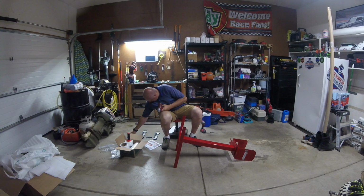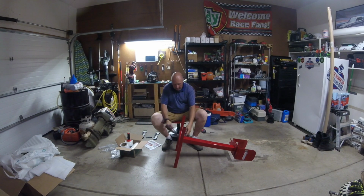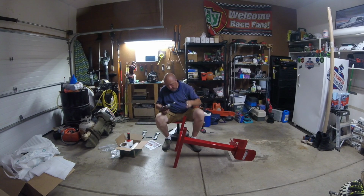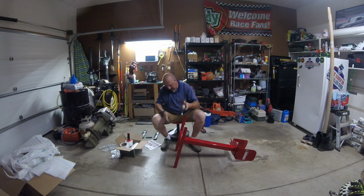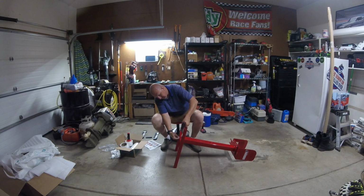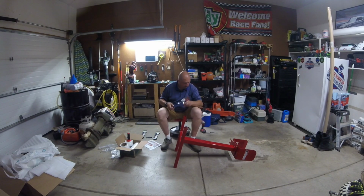So, grab our 9/16 here, put it on the bolt side. And yes, on this part of it, I will let her rip until she quits. 9/16. There she quit. Now we obviously can't get the impact on the bottom side here, so we'll do it the opposite. You can tell by the sound change once it bottomed out and pulled up tight.